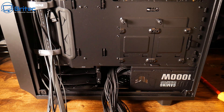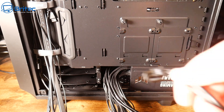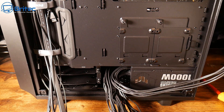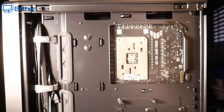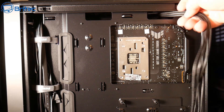Make sure you've got good clearance, especially if you're putting in a lot of RGB fans and other things like that. This will help to manage cables and tuck them into nice little crevices. Make sure you've got enough space between your power supply and your hard drive cage — this is going to allow you to tuck cables down here, which we call a stuff-and-tuck.